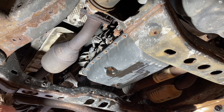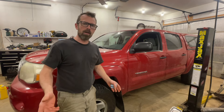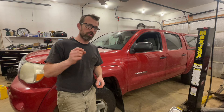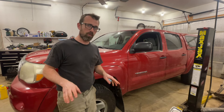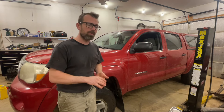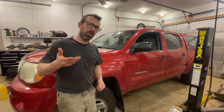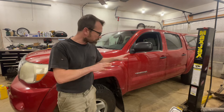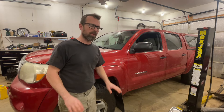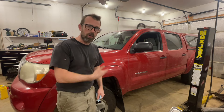Leveled and filled to the correct level — good to go for another 60,000 miles. Now that we've got this all done and back on the ground, you definitely want to pull that level check plug out with the vehicle on level ground. Whether it's up in the air level or back on all fours, if you're on jack stands you could lift the front up for most of the service, but when it comes time to pull that plug to drain the excess, make sure it's on level ground. So that's pretty much what's involved. Hopefully that helps you tackle a project like this at home in your driveway or garage. Thanks for watching.